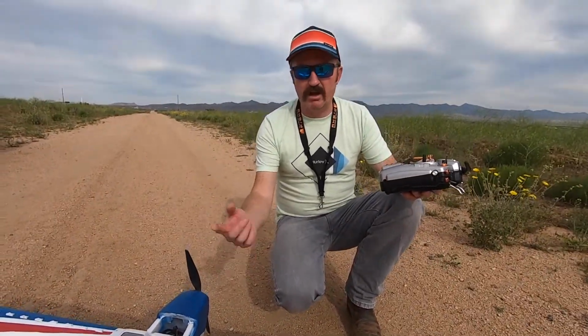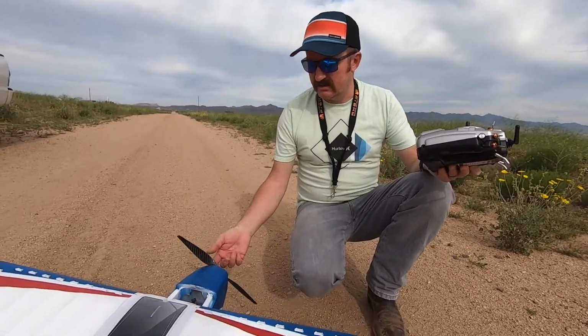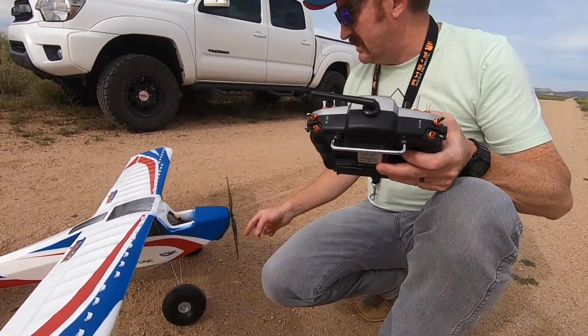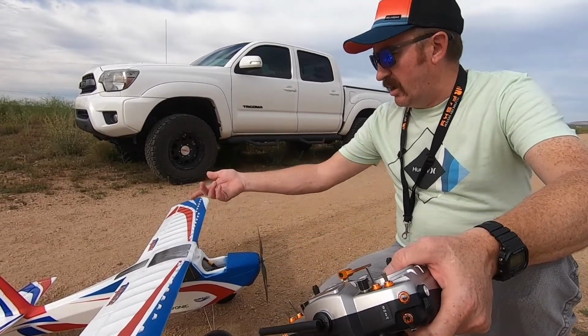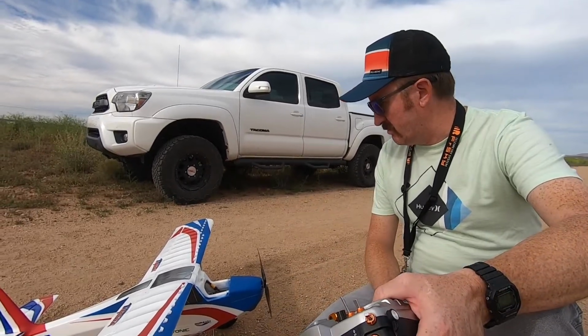So when I unplugged that lead, look at the motor now. It's spinning perfectly fine. So something with that reverse lead was causing almost like an electric brake. Like it was almost like the brakes were on. That's why it didn't feel right. I was like, something ain't right. But all I did was unplug that reverse lead. It's working perfect now. Cool.